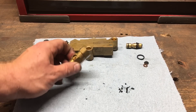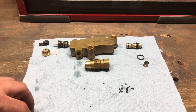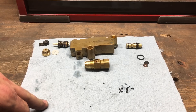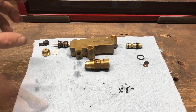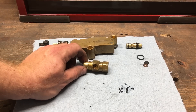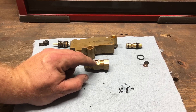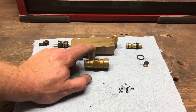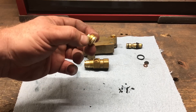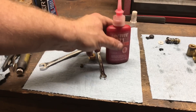I wanted to make a video showing what I got myself into. Correct me if I'm wrong, but you'd want to use rubber that's 100% compatible with brake fluid inside a proportioning valve. We're going to poor-boy-race it and try to find a way to safely and securely seal that hole, because brakes make a lot of pressure. I'm going to have to seal this hole because that cap is hollow and it's a fine thread that I didn't have any pipe plugs for.